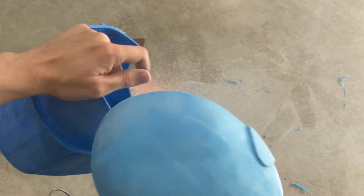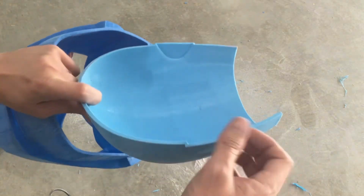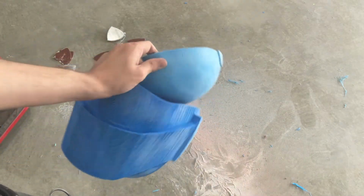But we'll prime it first, and then I find it easier to prime it, sand it, then fill it, or prime it, fill it, sand it. It depends on how deep it is. Sometimes the filler primer fills it up enough. But when it's all smooth, it's easier to sand the spot putty around it. I mean, that's just how I've noticed, but you do you.